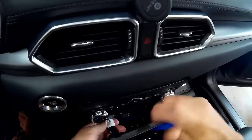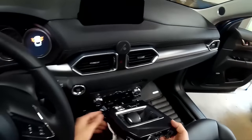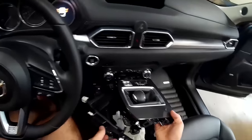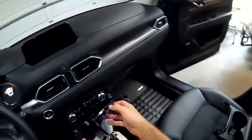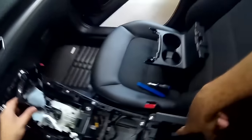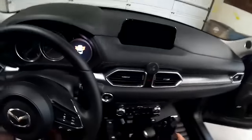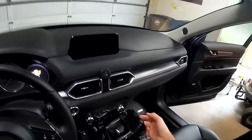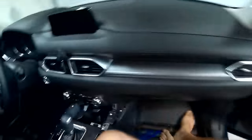Using my trim removal tool to push down on that — now that's off, and this whole thing comes right off the side. So now we have a straight shot from the armrest along the passenger side of the tunnel, which gives us a route for our wires. This piece does not need to be removed; it can just be pushed off to the side. We're going to remove the lower trim piece over here.